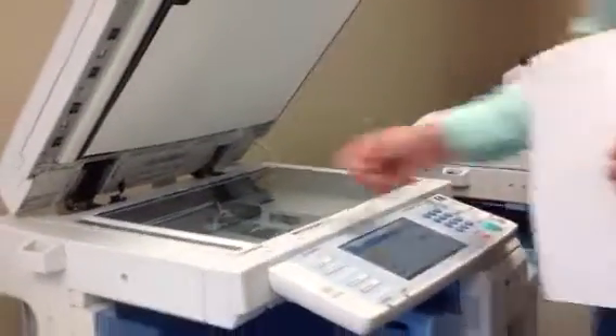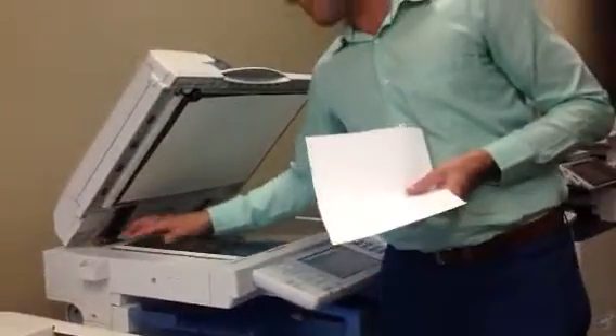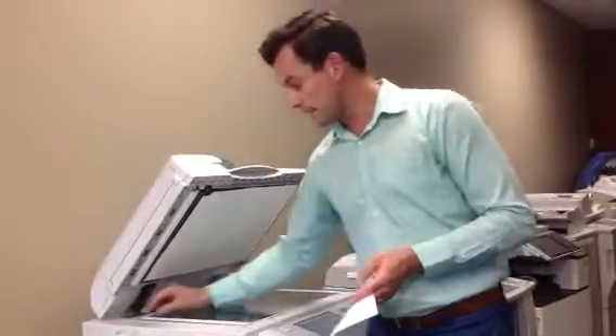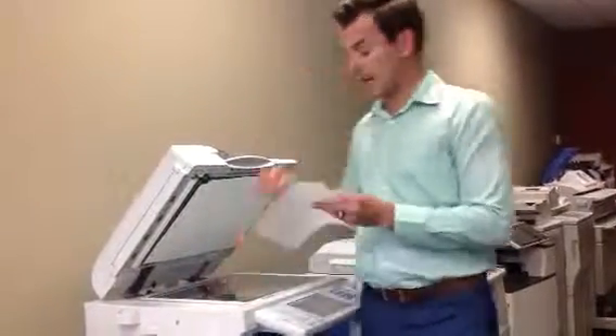The reason for this is exactly what I said — there's a speck, or there's a bit of paper dust or something like that on the glass, maybe even some flaky toner. So what you need to do is get a little bit of elbow grease, maybe some whiteboard cleaner or a little bit of alcoholic spray, and just either spray it on your finger or a little cloth and give it a wipe up and down.